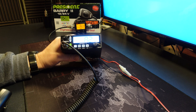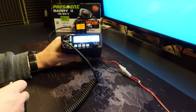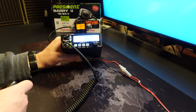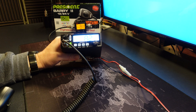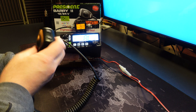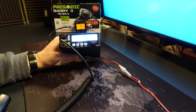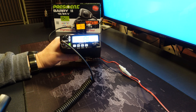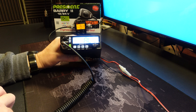A2 is the high power amplitude adjustment — you would be looking for roughly around 85% here. My radio has 3B as its current setting. I'm using the up/down buttons on the handset to move between options rather than the up/down arrow. AL is the low power amplitude setting and you'd be aiming for around 90% if you have the appropriate equipment to test that. My radio has a value of 31 here.